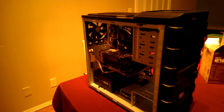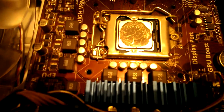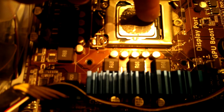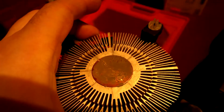I've got this nice big back plate opening. Let's pull out this stock cooler and see how the thermal paste looks underneath. I wanted to show you how the stock paste looked after pulling off the cooler. The CPU is not warm anymore — well, it's a little warm, I can feel some heat. You can see the paste there — looks all cracked and stuff, maybe I overheated it too much.